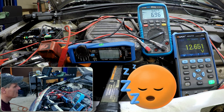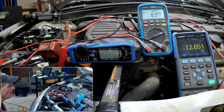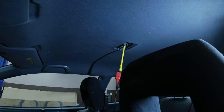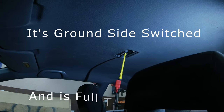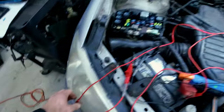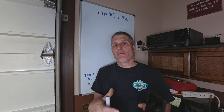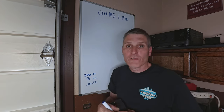A three-milliamp difference really isn't much at all. Most vehicles could be pulling 40 milliamps while they're sleeping; this one's only pulling seven since there are really no options. Inside the vehicle you'll see I took the bulb out from the dome light and hooked the wire up to the positive side — that wire comes out up over here. This just gives me an understanding of how I'm coming up with the amperage values for the resistors using Ohm's law.